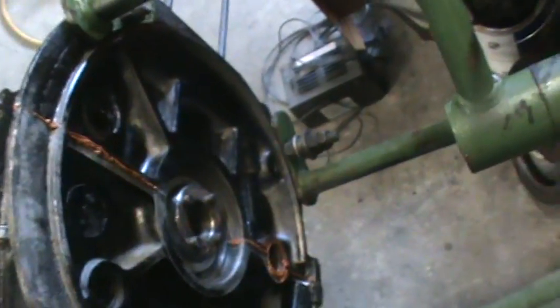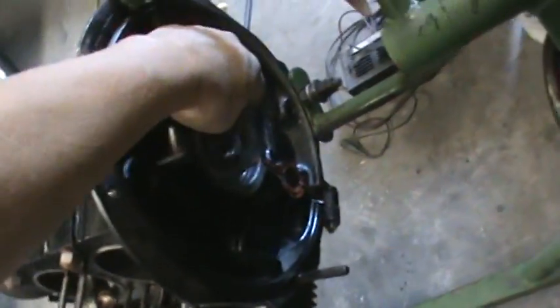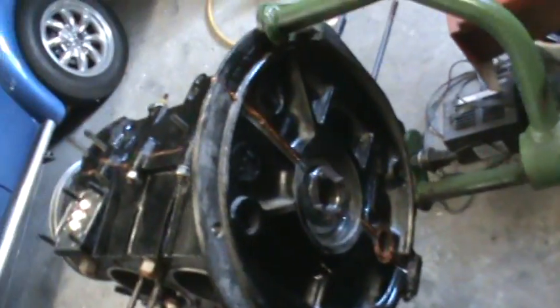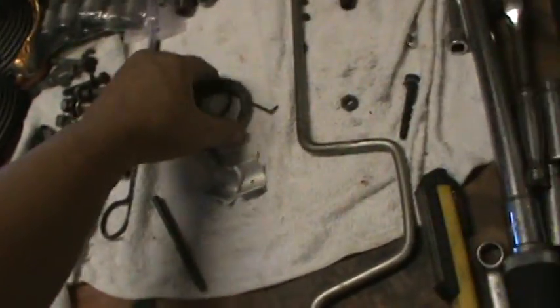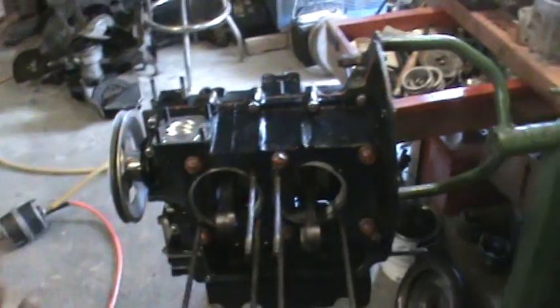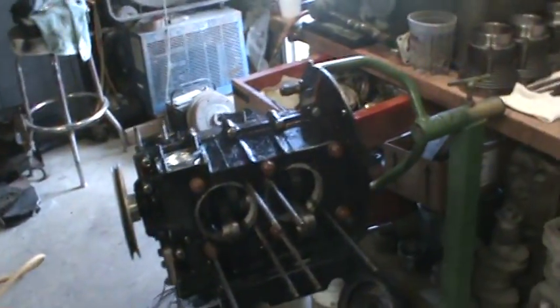The main thing to check is to make sure your crank moves back and forth — you want float, it's got to have it. That's set with shims when we do our end play. I usually start with 26 thousandths. You want about four to five thousandths end play after you put the flywheel on. I'll do a video on that.